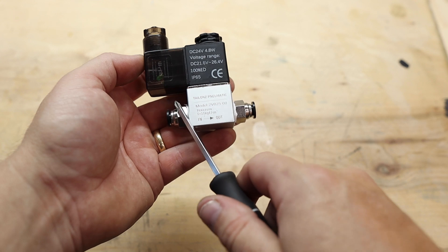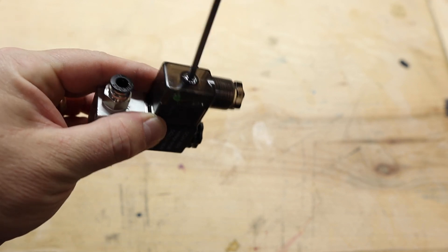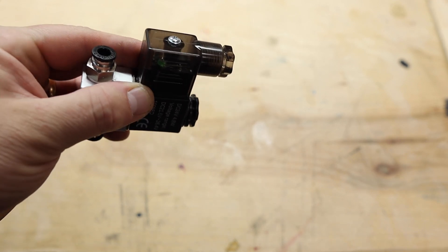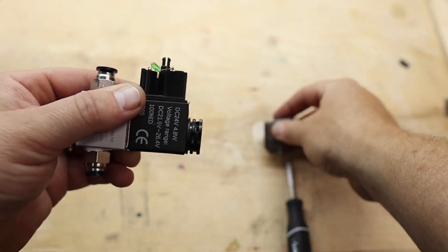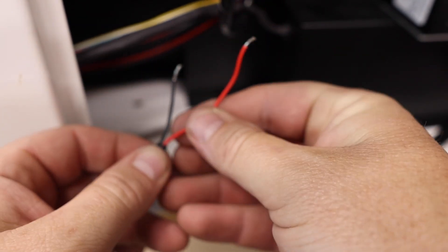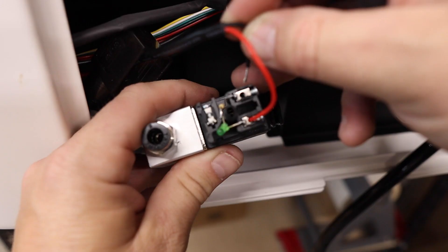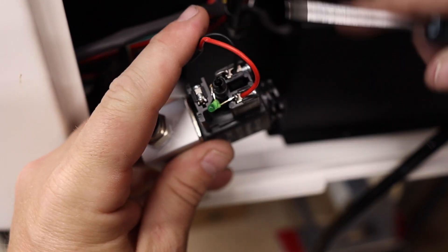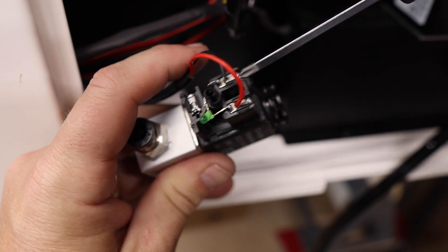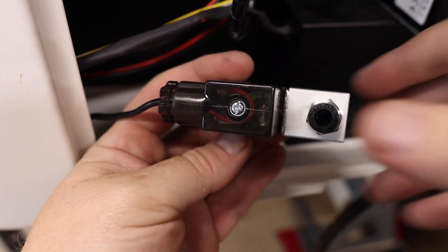Next, we'll hook up our solenoid. Remove the solenoid from the box and install the inlet and outlet quick connect fittings. These fittings are included with the solenoid, as well as the teflon tape used to make sure they don't leak. Then remove the screw on top and remove the transparent gray cover. Go back to your red and black wires removed from the stock pump and strip them both back about a quarter inch with wire strippers. Feed these wires through the inlet of the solenoid cover and insert them into the terminals — it doesn't matter which wire goes to which terminal, either way works. After the wires are inserted, tighten them down and replace the cover with the screw. Set the solenoid aside and start working on the air plumbing.